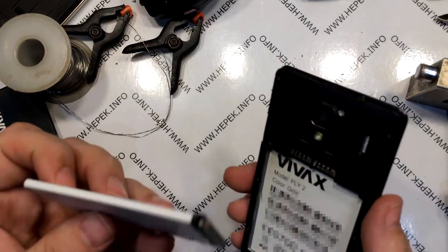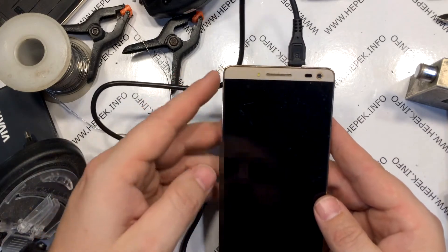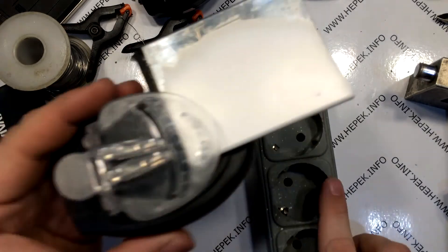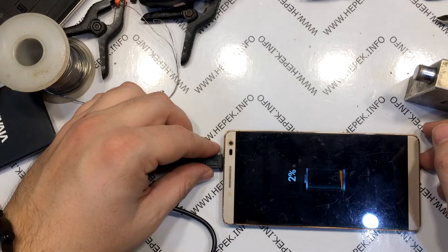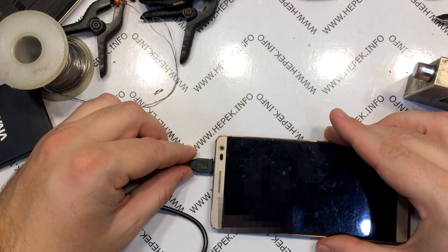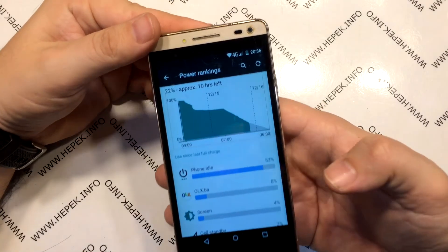I put the battery back in my cell phone, connected to the charger — and it's not working. But then it starts to charge, showed 0% and stopped. It's important to point out that the battery I've used is quite old and not used for a long time — probably the smartphone is not able to overcome it with its initial charge. I decided again to connect it to a universal charger and charge it a little bit more. After about 10 minutes I tried it again — excellent, it shows 2%. I turn on the device, let it go to standby, take out the battery, put it back in, and let it charge. Then I used the phone with an active SIM card for maybe a day and a half, and it still says there are 10 more hours of battery left.